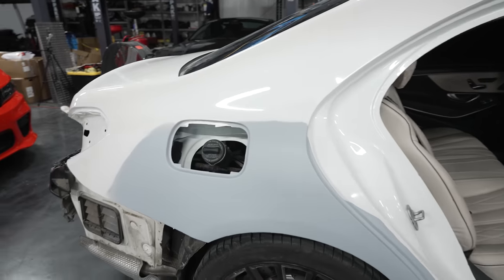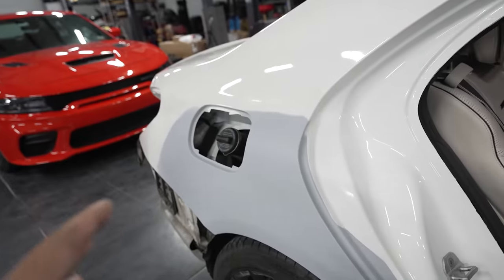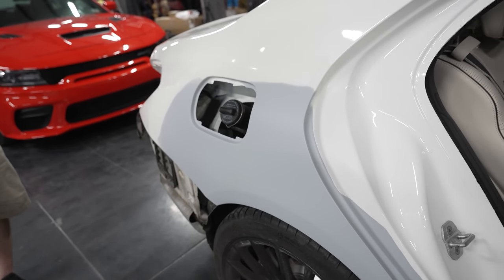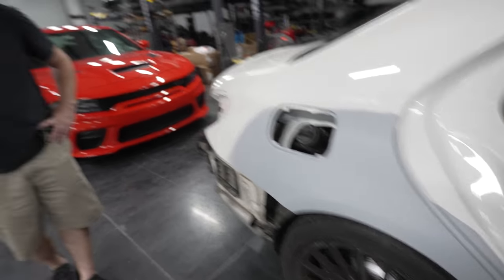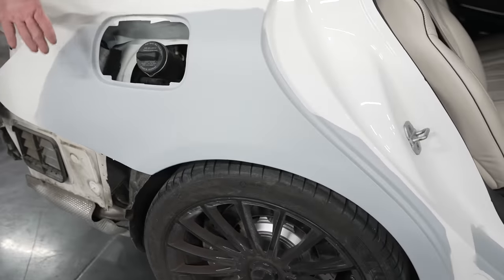But one thing is interesting because this is a steel panel, and what you said was that they could have actually repaired this way simpler than what they did. It seemed like they just didn't know what they were doing at all. Yeah, that was the level of repair there was just very amateur. I mean, even though you could be an amateur and do a good job, this was just something that was like, they put way too much filler, they put holes in the panel. Really, if this would have come to me, I would have actually used glue to pull this back out.